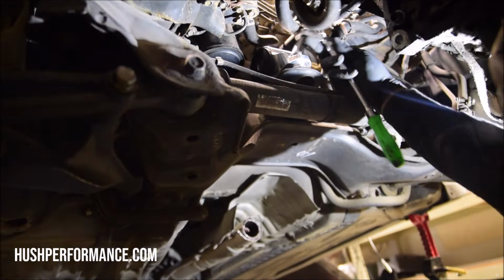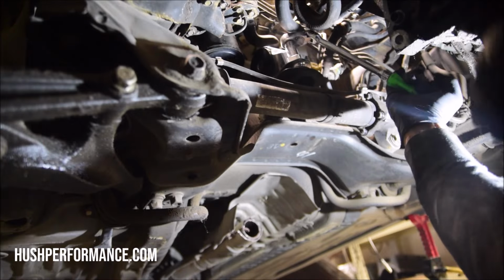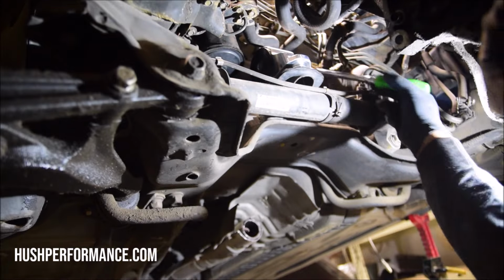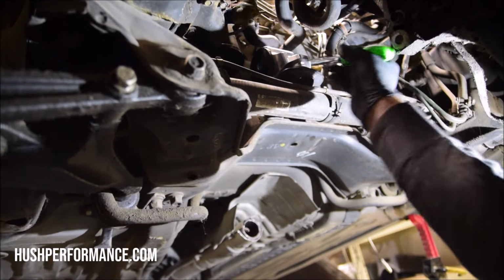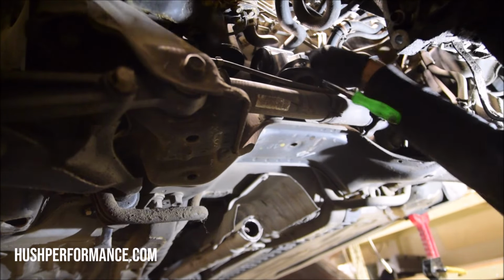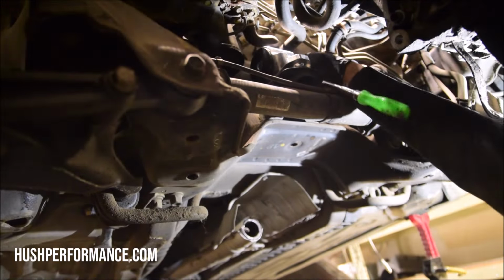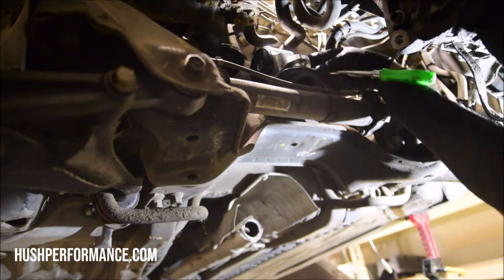The point of me showing you putting the mount in is to show you the tool that I'm using to do that with all the stuff in here. My go-to tool is generally a flex head ratchet just like this. I rarely need a straight fixed head ratchet. I mean, almost never. Because there's generally never a scenario where you're completely straight on a bolt head and you don't need some kind of flex in it. And so I never end up just grabbing my fixed ratchets, even though I have it. So right here, I have one of the extra long ones, and I use this almost all of the time. I have the shorter ones, but I rarely use it just because I'm always needing to torque something on or off. This is the most versatile tool in my box.